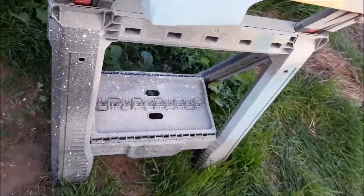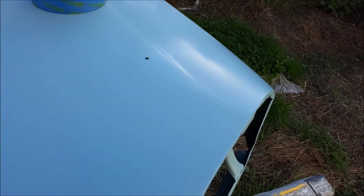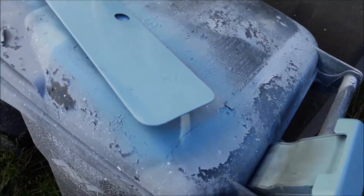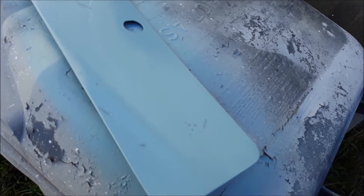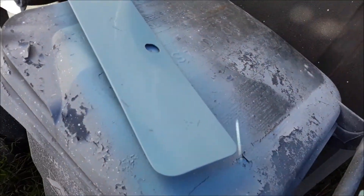The ashtray got its first coat, so I'll give it a second one. I'm not even going to try to wet sand that — just put clear on it and forget about it. This glove box door though had some stuff on it that the paint didn't like, because it's bubbling. So I'm going to wait for it to dry overnight, sand it all down, and try again. It's not a big deal at all — I'll just sand it down and do it again. For today I think that's pretty good. I'll do the clear tomorrow because I only have a window of a day to deal with this stuff.